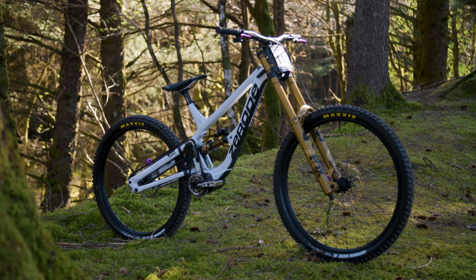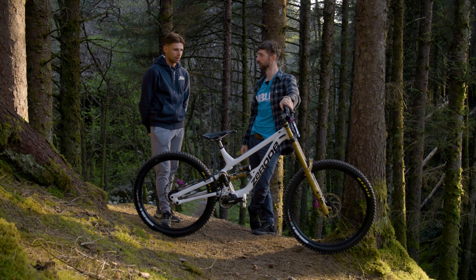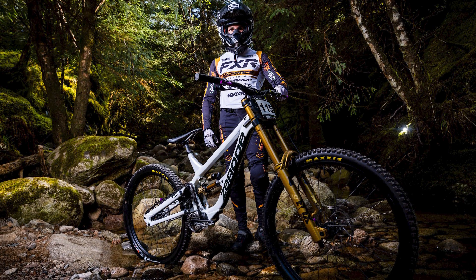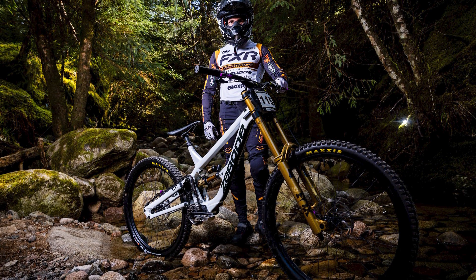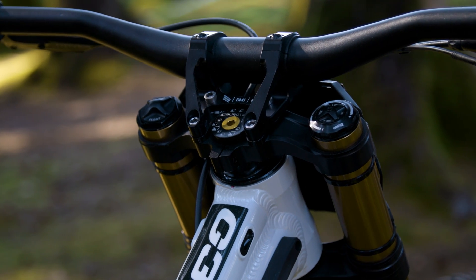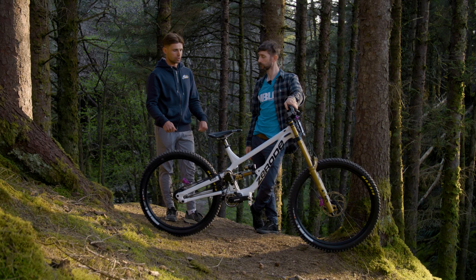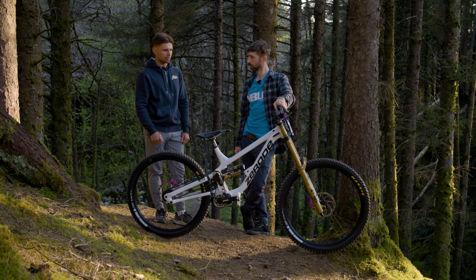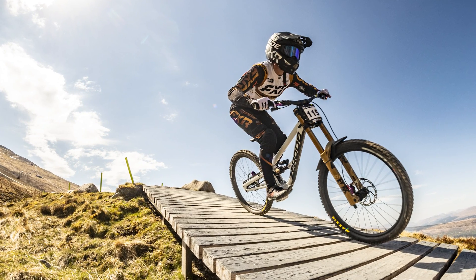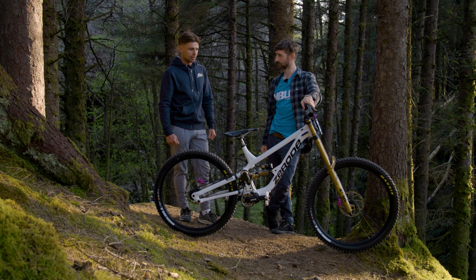Back to the rest of the bike — it's mullet specific, so a 27.5-inch rear wheel. What size do you run? I run a medium. I was on a small pre-production bike, so I've kind of brought this back to small size with a minus-six reach adjuster and a shorter 35mm stem. I'm normally a standard medium guy, but I'm really liking a smaller bike at the minute — the smaller reach. If you notice riders at the minute, they're really just standing tall and letting the bike do the work, and this bike helps you do that a lot.